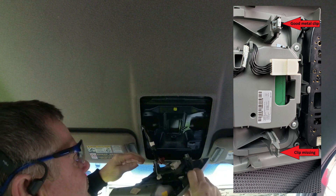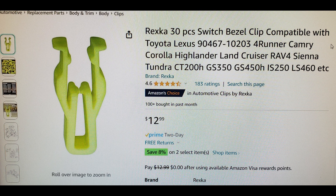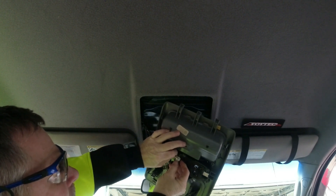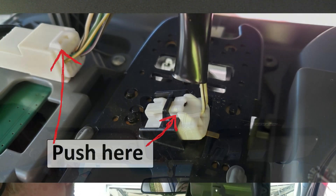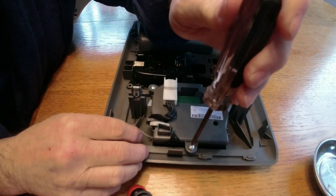At this point, you want to inspect and see if you're missing your mounting tab. In my case, I lost one. Luckily, I managed to root around up there and find it. If you can't find it, you may need to order one or two new ones — here's the part number. There are two electrical connectors that will have to be disconnected on this panel: one for the two map lights and the other goes to the display we're trying to repair. On the back of each connector is a little tab — push on that tab, then pull on the connector and it should pop off.